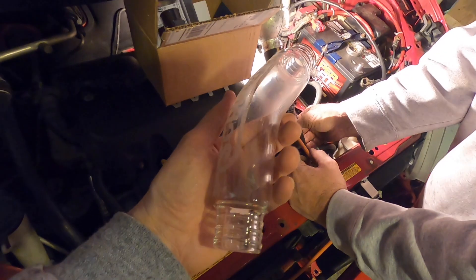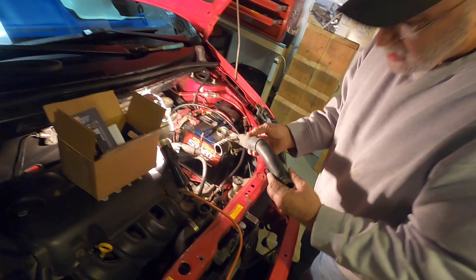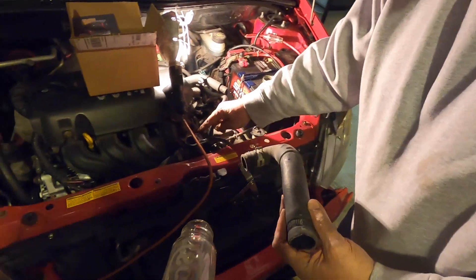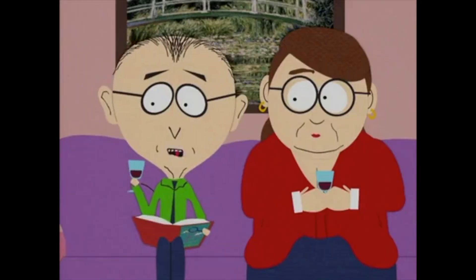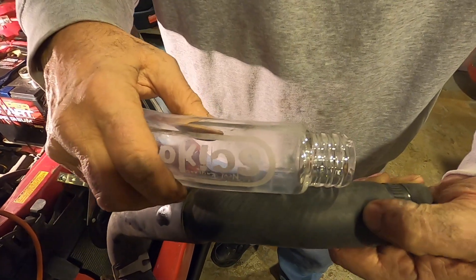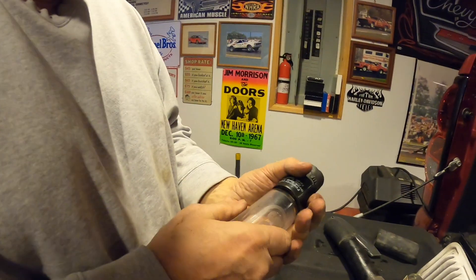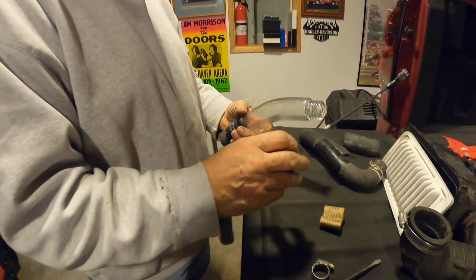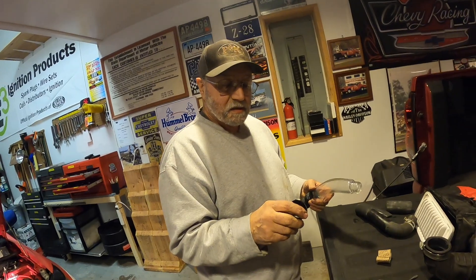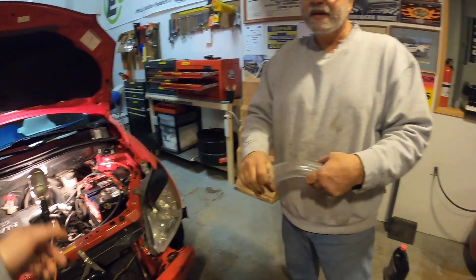This takes up a lot of real estate in there. The hose is off and it goes almost as far as where the bend is. We need this distance for the nipple, and then the shrink tube goes over it. If that one fits — this one glides right on — so maybe something happened with that one, like it already heat-shrank.